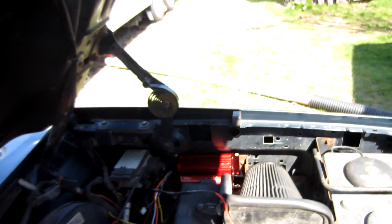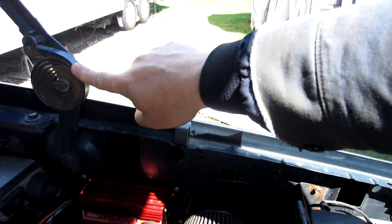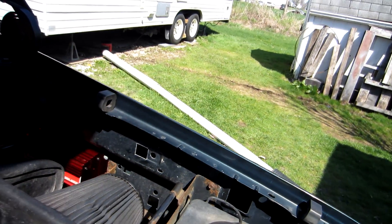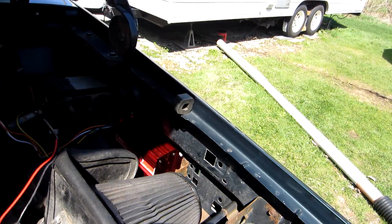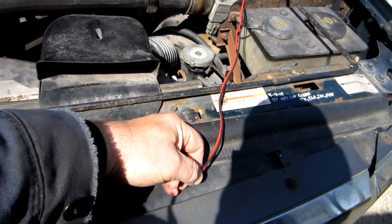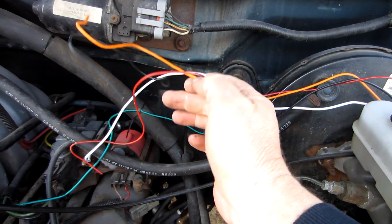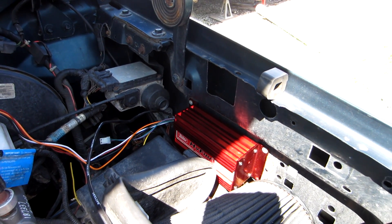New game plan and I'm kind of excited — there's where the box is going to be mounted now. I'm happy about that because I wanted it over there in the first place. The only thing to watch is that when you close the hood it doesn't hit it, so you have to mount it low enough. I like that it's over with all the other electrical — no interference issues. It'll also be easier to access whenever I check for spark since there's a little port with a red light that flashes to let you know everything's working. I only have to lengthen two wires; all the other wires reach easily. I'll route them up and around the brake booster and put convoluted tubing on to make it look nice.